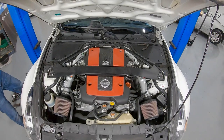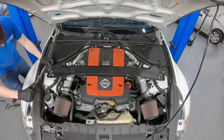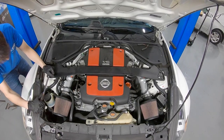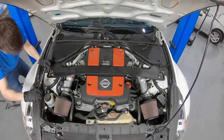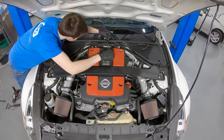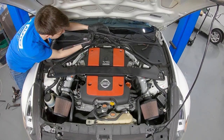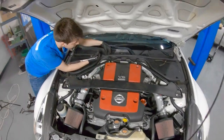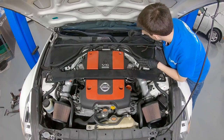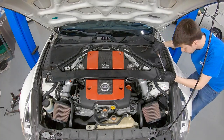Okay, so now that I bottomed them out with the electric impact, I'm gonna take the ratchet and snug them really tight. Keep in mind, I'm only using a 3/8 ratchet, not a big half inch. So I'm not making them crazy tight. Replace this plastic piece. Replace the weather strip. Put the push clips back in. And then snug down the other side.